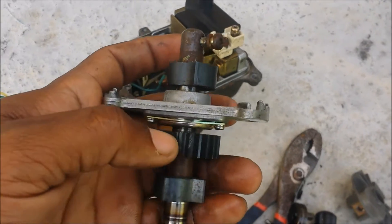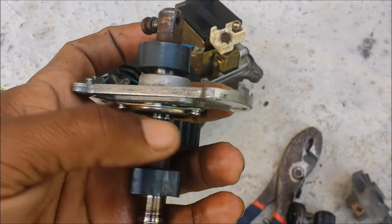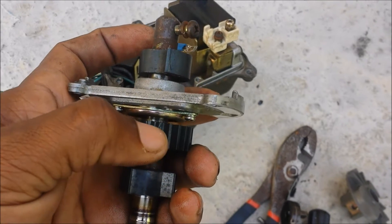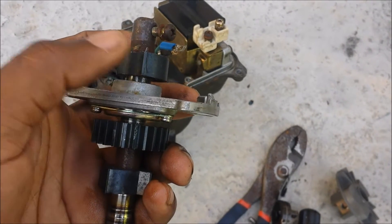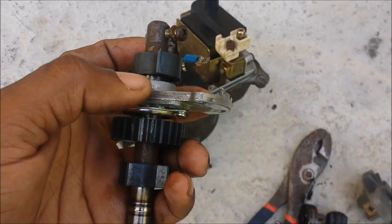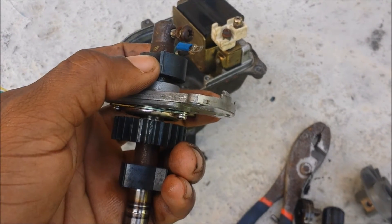To do sequential, you would have to use two gears — this one is a 24-tooth, and a single tooth. This would be crank speed, and this one would be your cam speed, or your home, whatever you want to refer to it as. So it will basically be a 24-plus-one setup. The one tooth is the home.